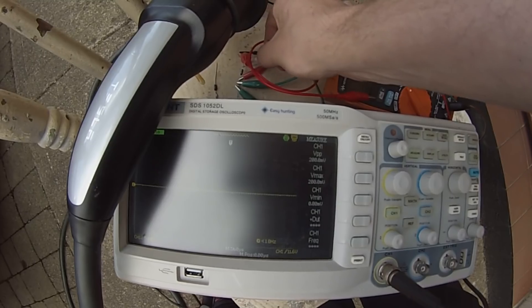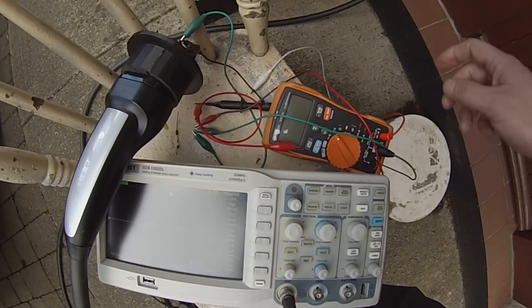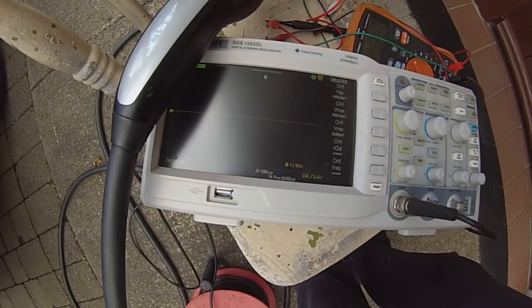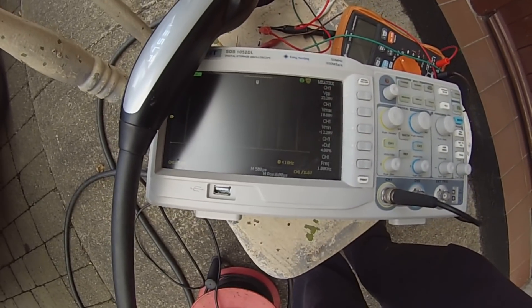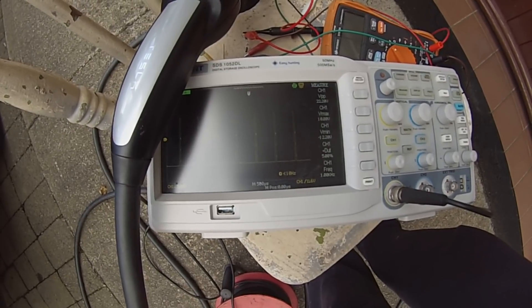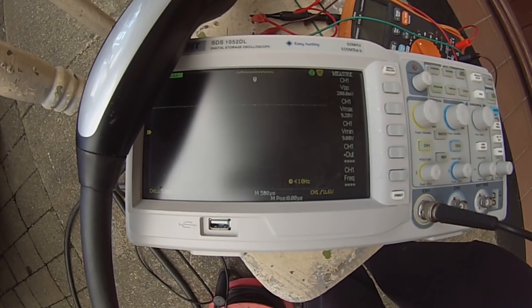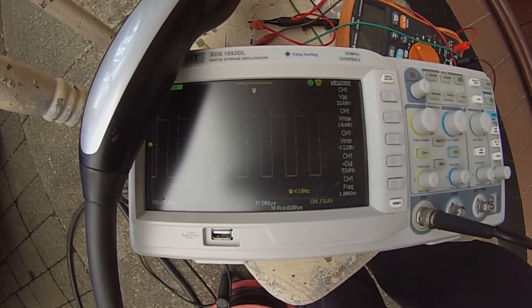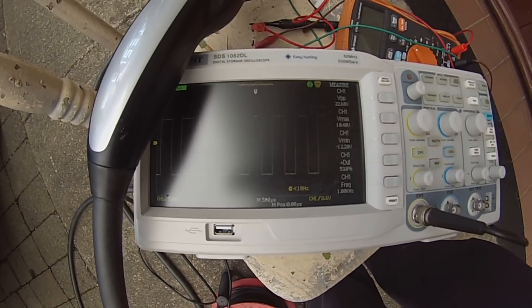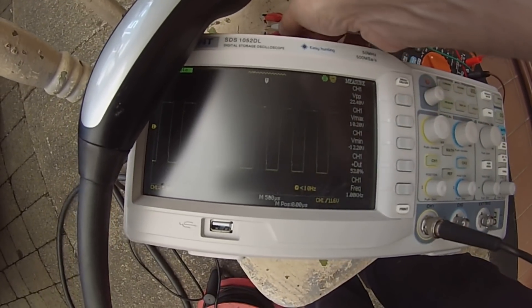On the other hand, if we disconnect and remove the second resistance so that we have state B — which is 2.7K — and we reconnect and watch our oscilloscope screen, we PWM at 5% duty cycle, which is requesting digital comms, and then we time out and go back to 12 volts DC, then back to PWM.